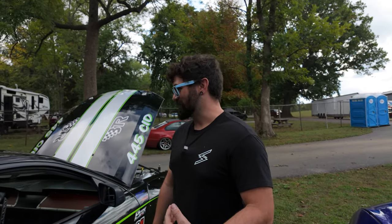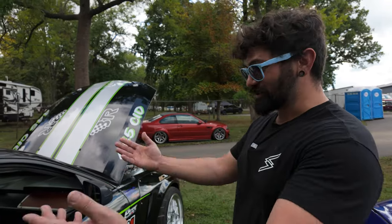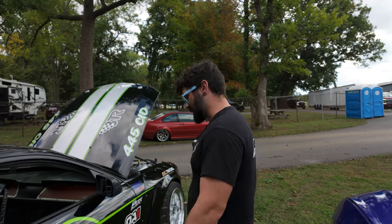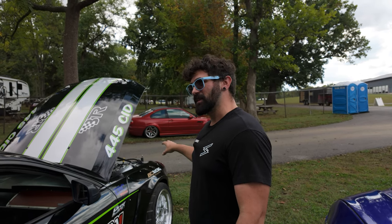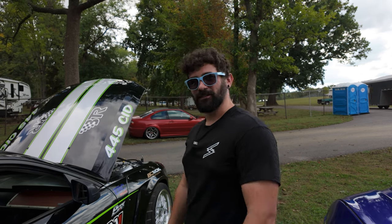I'm definitely looking at CageKits — once I'm ready to delete my AC and cut up my dash. As a fab guy, for the price they sell these cages, you can't do one by hand for that price. For suspension, it's BC coilovers — just off-the-shelf BCs. I'm running 5k rear springs and 14k front springs, and I may beef up the front springs for next season — I think I could use another 2 to 4k on the front.